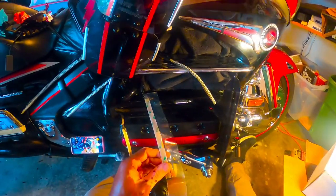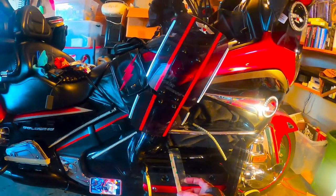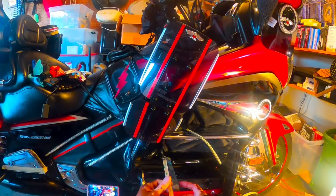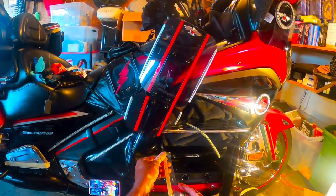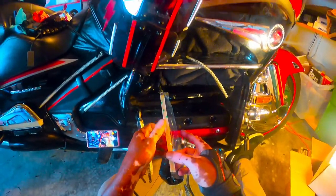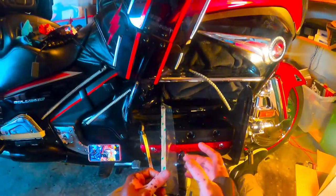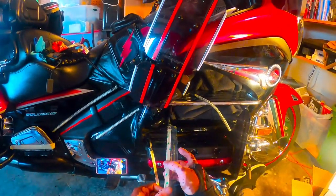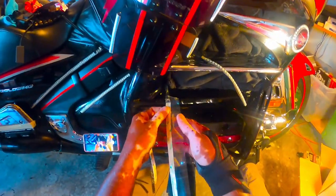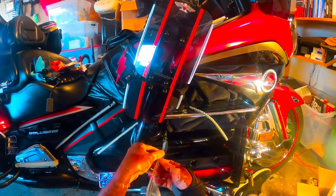Cut the length of the flex tape or the repair tape. Now you need to wrap the flex tape from the back. Do not do it from the top to the back. Do it from the back to the front, because it's coming back to the back. Do not start in the front, because you're going to end up with an open layer in the front. So do it exactly as this. Cover the back, then flex the tape around to cover the front.